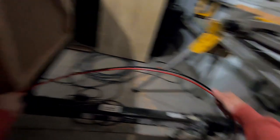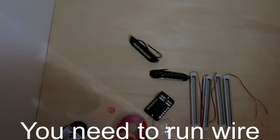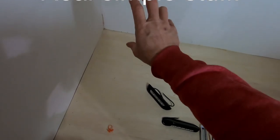That should be plenty of wire to reach that fuse panel, and plenty of wire to come up here into the battery box — so we're good that way. Now I'm going to get out the 12-gauge wire and run it from the back in the galley up to the front here, where I'm going to put USB ports.